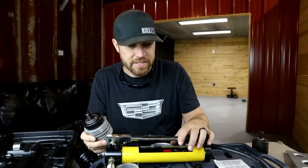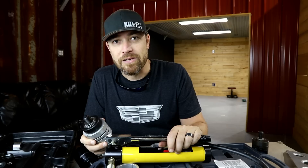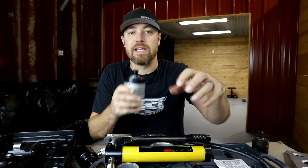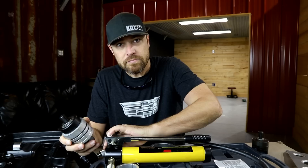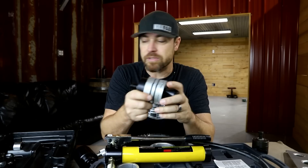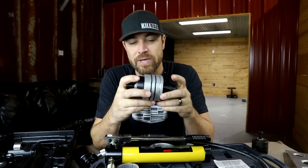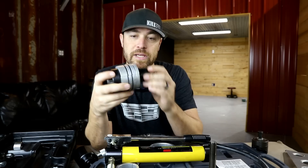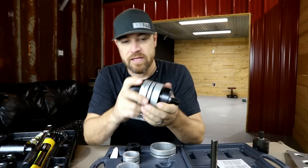I really like the handheld version. You can work in cars with these if you want to pop holes in interior sheet metal bracing — if you're just trying to lighten the car, you can really do that fast. Drill a little hole, put the stuff together, pop those holes, put little cool beads or flares in there and get the job done. You can take this thing wherever you need it to go and it'll work just fine. Aluminum tubing works phenomenally. It will do others if you had to — you could probably make it work, probably not the best situation. Anyway, the Lisle pipe expander kit — this week's tool.